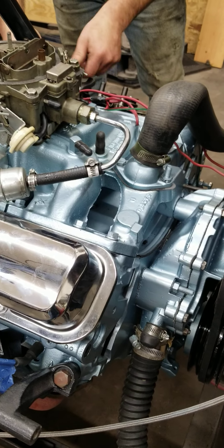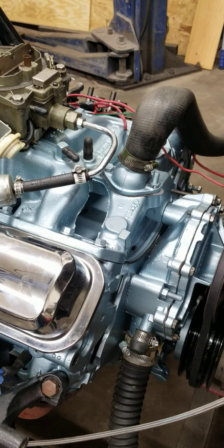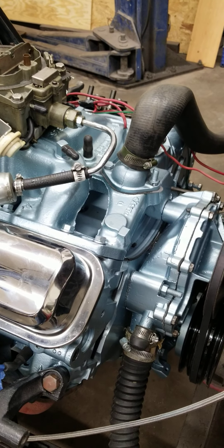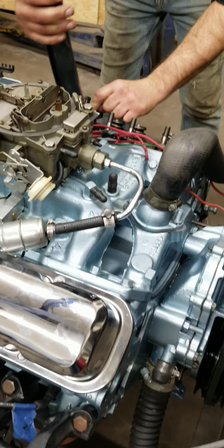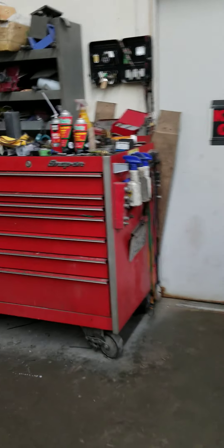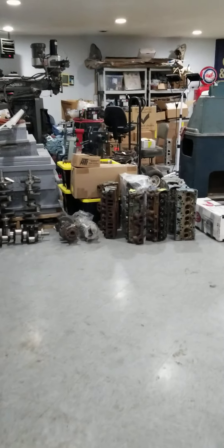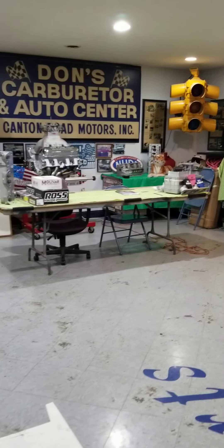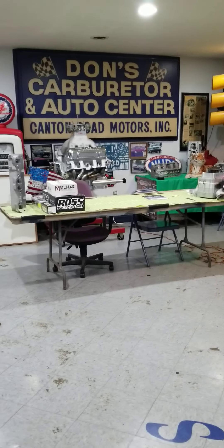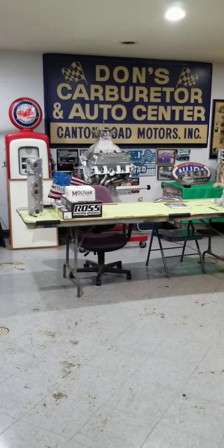So it's not the camshaft, and the hardness on the cams is fine. What he found was the lifters are actually hard like they're supposed to be, and they rock right where they're supposed to. But the problem is the machine work is so shabby on them. He found out that the actual bottoms of the lifters don't have the proper taper on them, and they're chattering — the contact area is not correct. So he's re-grinding the lifters, and we had these reground.